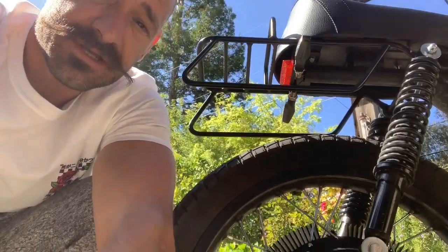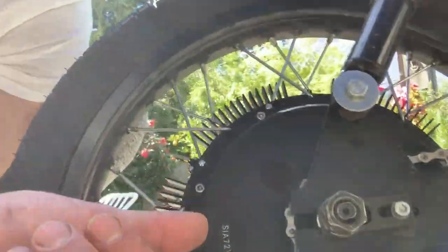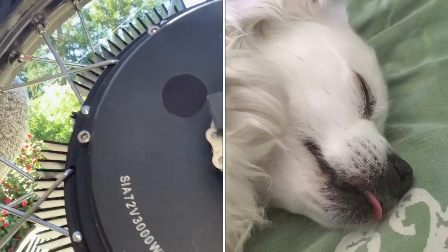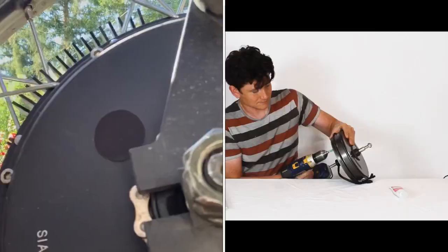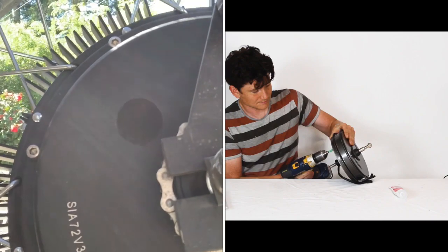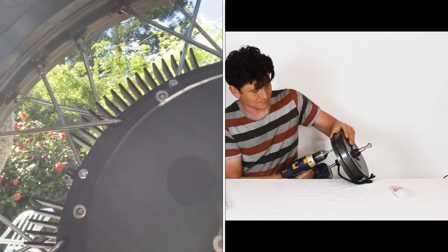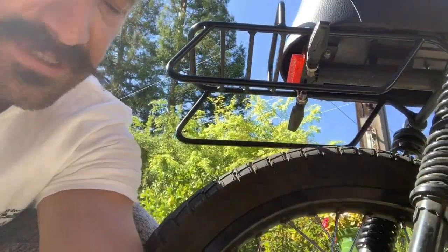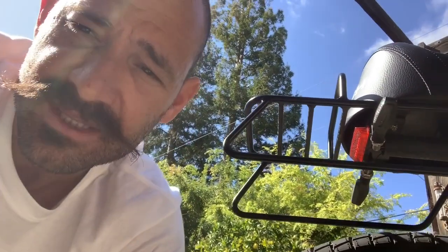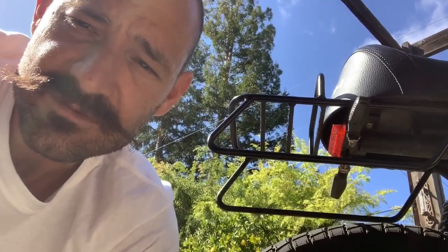The other way — sorry, dog interruption — what I ended up doing is drilling a small hole in the motor. You can see the patch on it: that's a Gore-Tex adhesive patch I got online to make sure no fluid escapes. The fluid always rests at the bottom, and when you're riding, centrifugal force pulls it to the outside where the magnets are — that's where you want to keep the temperature down. By drawing heat away from the stator to the outside of the motor, you allow those fins on the outside to be most effective.